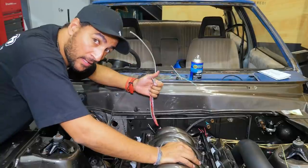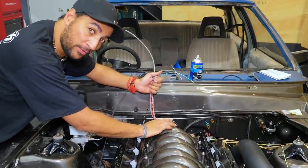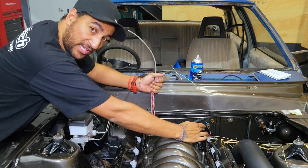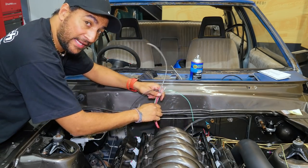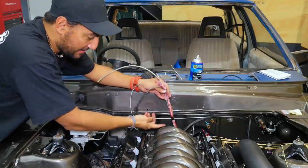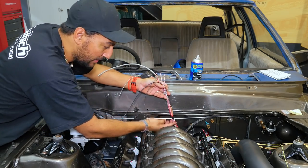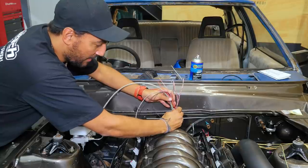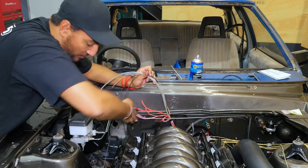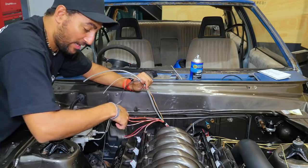Last few things for today - I've got the factory oil pressure sensor which is hiding down the back of the manifold here, so I'm going to throw a plug on that one really quickly. I'm going to braid these wires with some of the sheathing, separate these down at this join I made here, so we'll make a big fat common one to here and then split all of these except for the power ones, then run that back down under. We might need to throw a little bit of protection over these wires as it runs past the manifold.